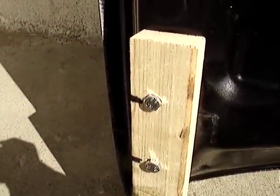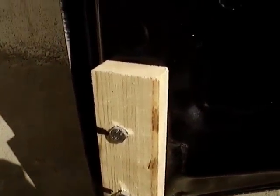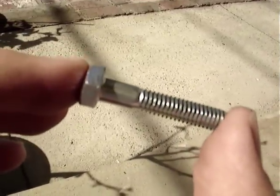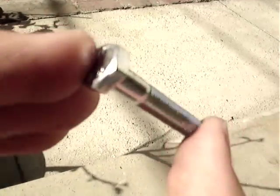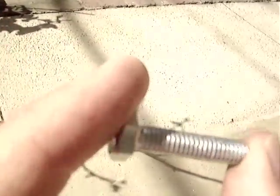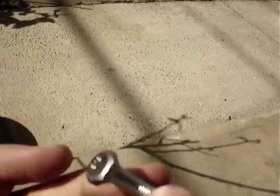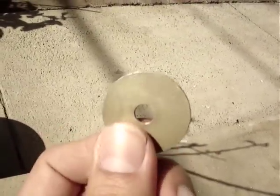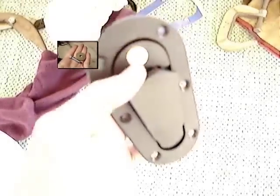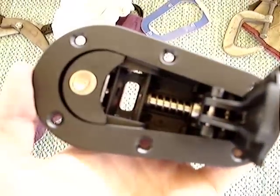Also, as a side note, do not use the bolts that came with the hood to mount these little wooden stands. The bolts that secure the wooden stands are not full thread, so you won't be able to tighten them all the way down properly when you mount the hood. You can find a 6x20mm bolt at almost any auto parts store. Odds are you won't be able to find one that has a very wide head, though, so use a washer in addition to it. That'll give you what you need. Pretty heavy duty.